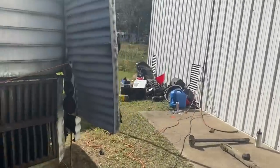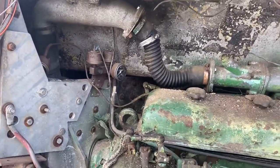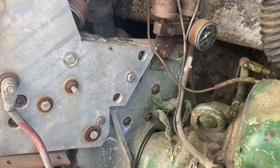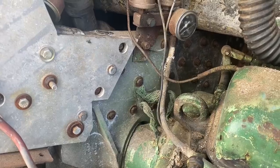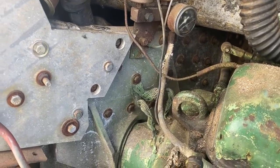All right. You ready for the real shit show part of this job to start? Pulling the trunnion? Yep. So now is the part where we pull the motor mount off. We wanted to get the bus up and supported where it wasn't going to have to move anymore. And we're going to pull this all out over here and get it to a fab shop to get remade, and then we got to reinstall it. Old bolts, steel and aluminum together, holding up a 3,000 pound engine. This is gonna be exciting.